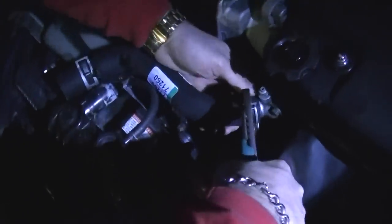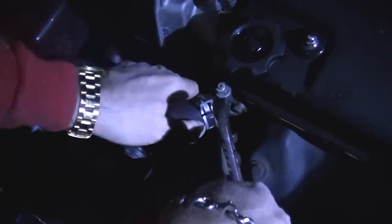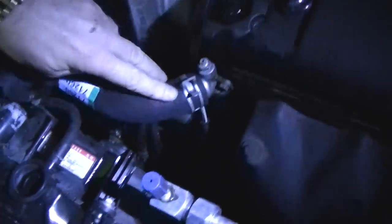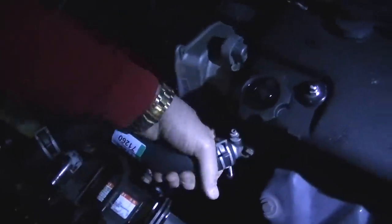And it goes on really simply like this. There are these metal clips that sort of just hold it in place, and it's not that hard. It just clips right back onto the engine. You just have to make sure it passes the edge of the pipe. So you push it in so it's nice and snug. The clamp has to be over the hose right onto the metal — otherwise, if it can slip off, it's going to come right off. You want to make sure it's snug and right there.